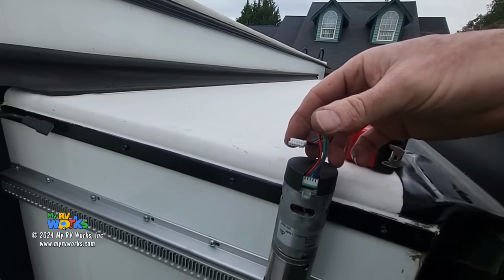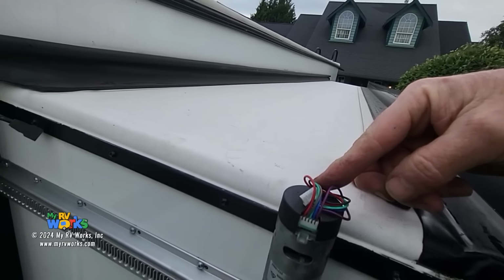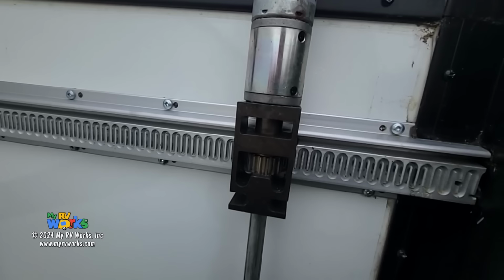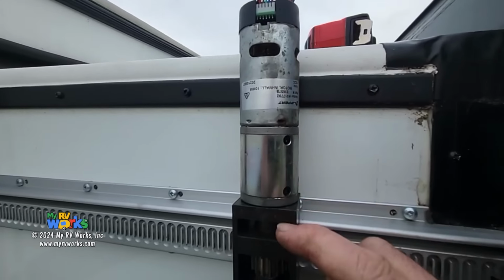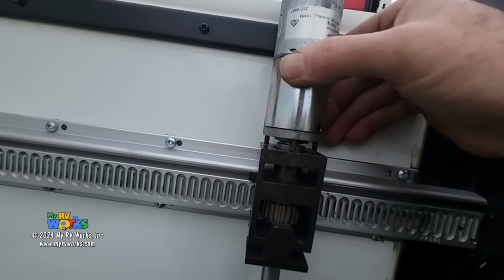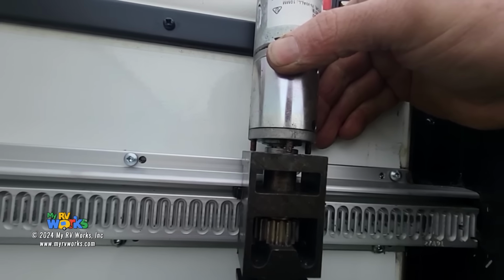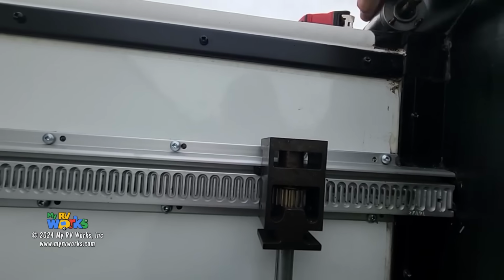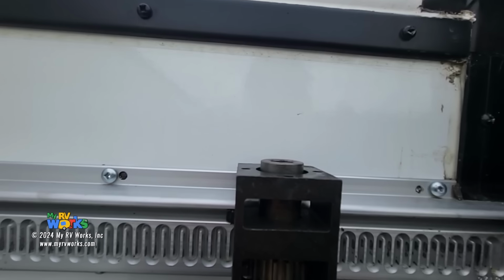And then when our plug here gets connected, we can just make a little nest of it right on top. Sometimes you can put some tape on there to hold it in place. And then the motor screw goes in one of these little windows from the outside. So let's go back to what we were talking about. And that is, if you cannot get your motor to seat in, we have had some questions from folks that just say, look, I can't get my motor to seat in. We want it to be like that. So I'm going to take the motor out of the equation. And if you were to take your motor out, you're going to notice that your collet is bumped up just a little bit.